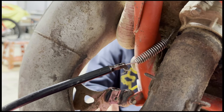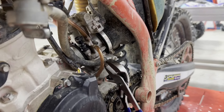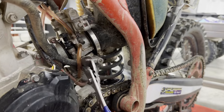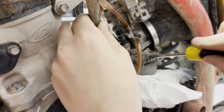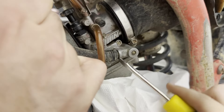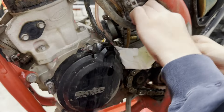Got to get it past the hook — kind of wiggle back. So the gas is already off. Take your pliers and pinch that clamp and slide it up the hose. You can use both hands. I would lay a paper towel up in here because you don't want gas sprinkling out, and then grab that flathead. Take the flathead and go straight in and then just rock it side to side. This gas line's probably been on there for a considerable amount of time. Welcome to being a mechanic — get more paper towels.